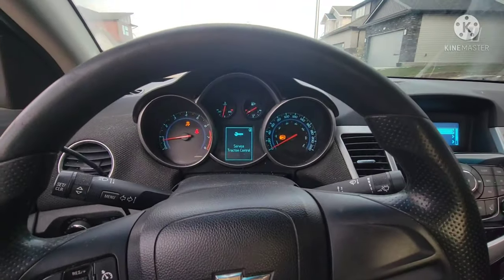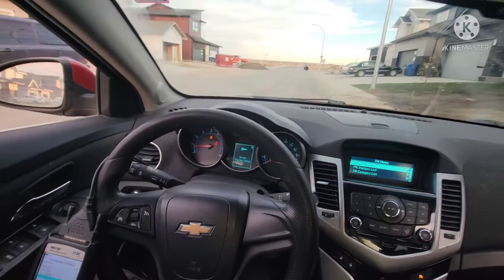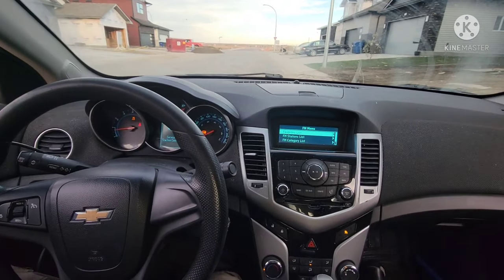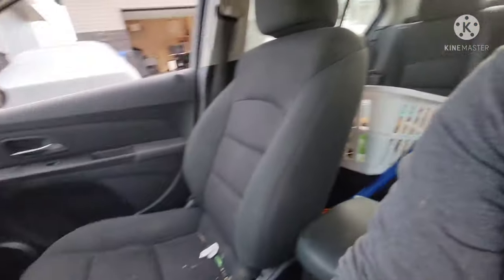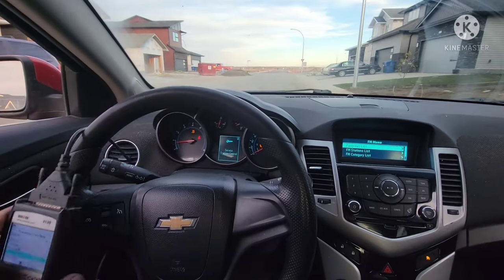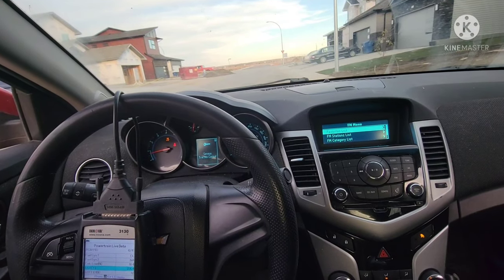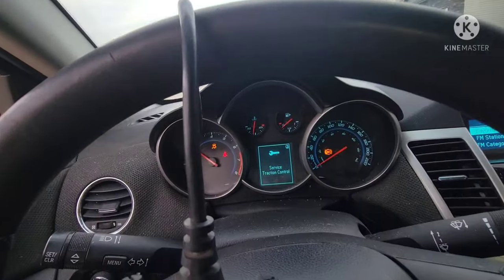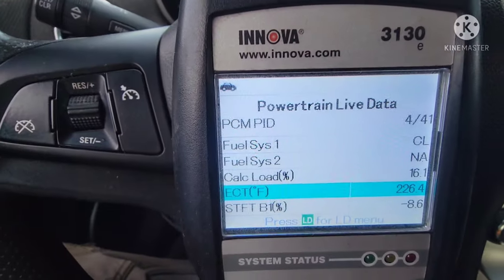Driving this car it feels like it's gonna pull apart — this thing needs suspension or a ball joint, and definitely needs brakes. The brake pedal is pulsing. Anyway, there's a lot of concern here — definitely need to let the dad know what's going on with this vehicle before we hand it back. But so far so good guys — the timing job is done, confirmed it's fixed. Thanks for watching, see you on the next video.